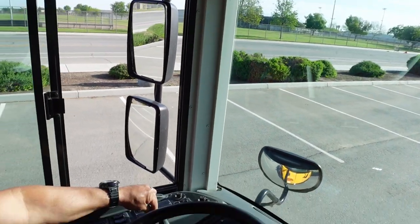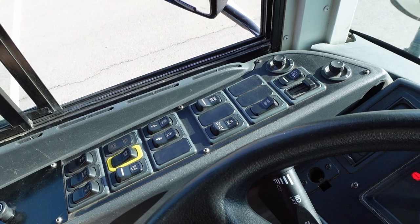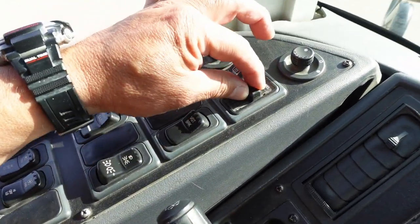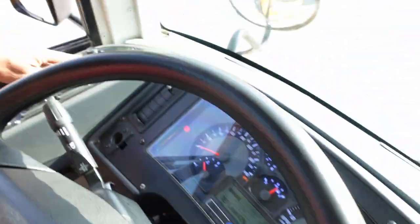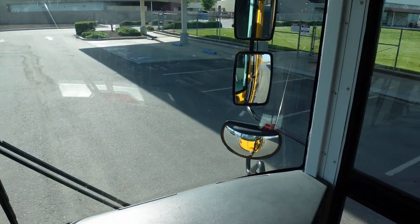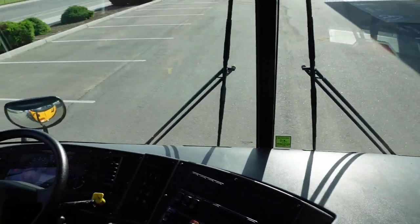I have my switch for my headlights — parking lights and headlight. I have my switch for my high idle; the way I check that is the tachometer is rising, so that's working properly. I have my switch for my brake retarder — on and off. I have my dimmer switch, which is working properly because you can tell it's dimming the lights on the dash. I have my switch for my mirror defroster — on and off. I have my knobs for mirror adjustments. My left flat and right flat are adjusted to see one inch of the bus, 200 feet to the rear, and my rear tires touching the ground. My cross-view mirrors are adjusted to see the front and sides of the bus, which are immediate danger zones. My inside overhead flat is adjusted to see all emergency exits and all students sitting behind me.